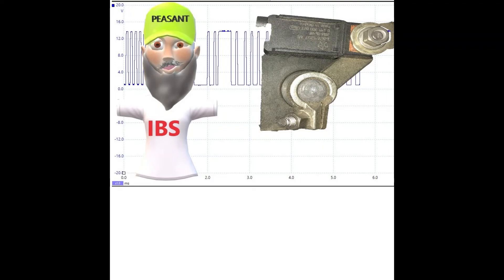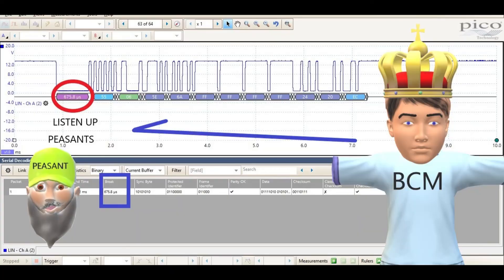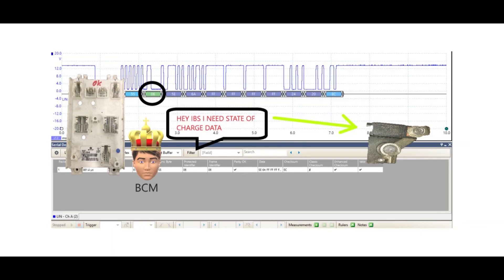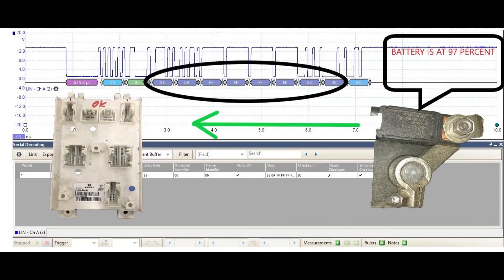We're going to talk about what this signal looks like. It's a digital signal. You're going to see battery voltage when you turn the ignition on. And then if you see communication happening on a LIN bus circuit — any LIN bus circuit — you're going to see maybe 8 to 12 volts somewhere in there, depending on how much communication is going on and how many modules are on that LIN bus. You can have up to 16 modules on a LIN bus system, and most of our vehicles are just going to have the IBS going directly to the BCM, though internally the BCM might share that in a parallel splice.